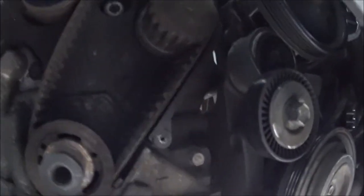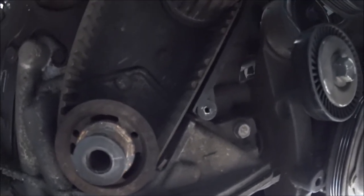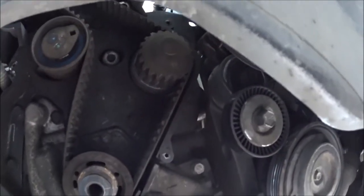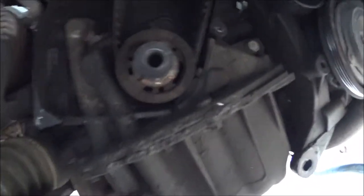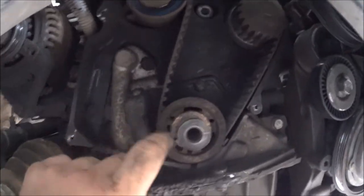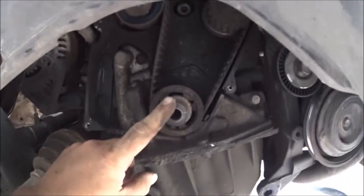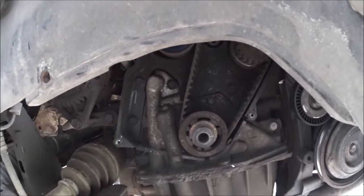We're going to drain the radiator and pull the water pump off, get the water pump replaced, take the cover off to get to the tensioner and idler. Then we'll pull the cover off and get everything reassembled and lined back up. There are timing marks on the crank and up top on the cam gears. What you're supposed to do is put the crank in the middle so all four pistons are down, then realign the upper two cams — you can rotate them completely around without any interference.